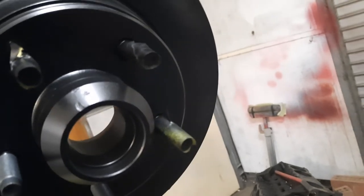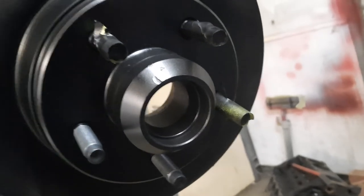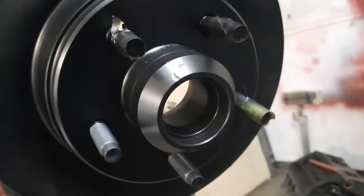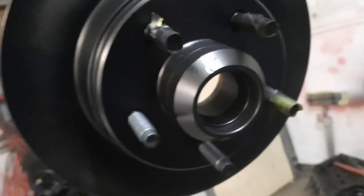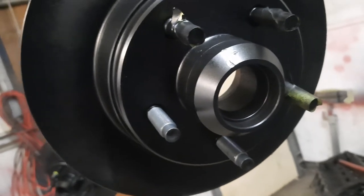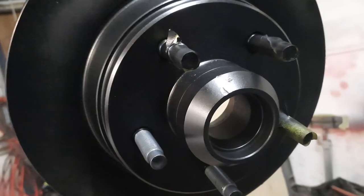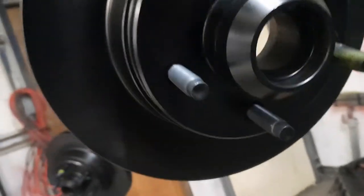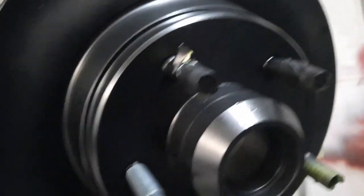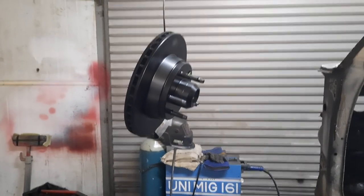If you're checking for steering play — side-to-side movement — it could be a tie rod end, steering box, rack and pinion, any of that. If you're specifically checking wheel bearings, grab the wheel top and bottom. A bad ball joint can also give movement there, but when checking if you've done the bearing up enough, hold it top and bottom. Anyway, hope that's helpful to somebody — bye!